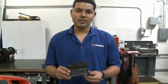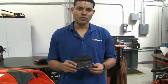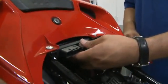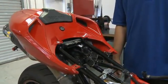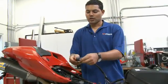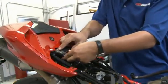The first step of the installation is to find a mounting location for the control unit. On this bike, we're going to place the control unit under the rider seat. We've got the harness out of the box and the first thing we're going to do is install the fuel harness connector into our control unit.